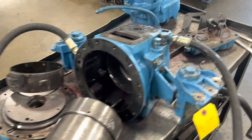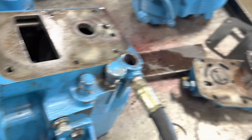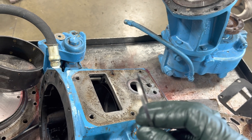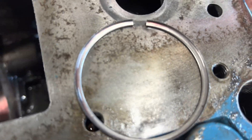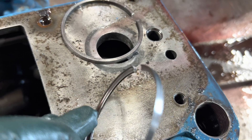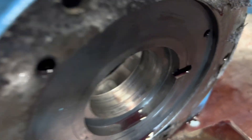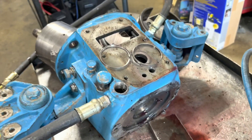Alright, got our PB-32R apart and I believe I already found the source of the issue. These sealing rings - look how this comes out, it's worn terrible. See that groove there? This is what the other one looked like, and that's for forward. See how cut down that is - it's over half worn. And that rides in the case; that's where the fluid comes in to activate the forward clutch. So that's grooved and we're going to have to clean that up.